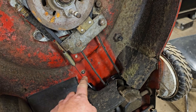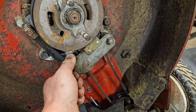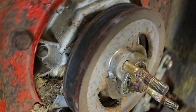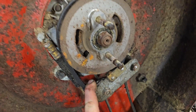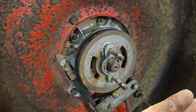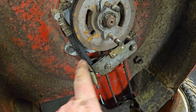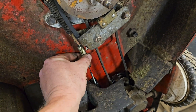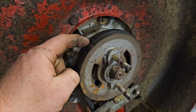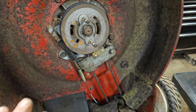Here's the cable that comes from up on the handlebar — this is the cable that pulls when you engage that bar. What it does is it pulls this arm back, and what that does is it pulls this belt. There's a belt in between two sheaves, and it pulls the belt tight, engaging this top drive sheave with this bottom drive sheave with your blade attached to it. When the belt gets tight these spin together and the blade spins.